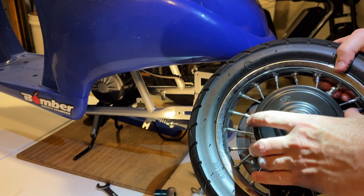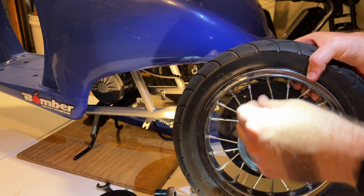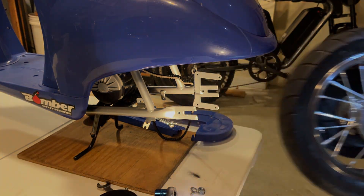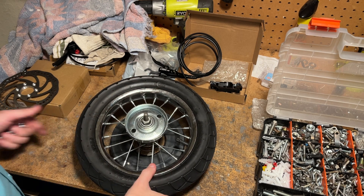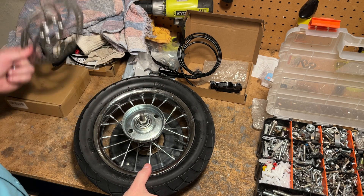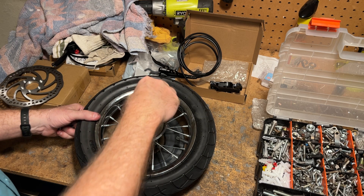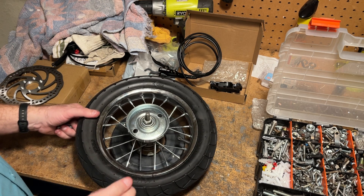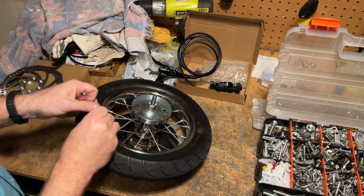There we have it. I'm going to remove this brake. This is the drum brake that I need to remove and then attach the disc brake to. In order to remove the factory drum brake, you need to turn it counterclockwise and then install the disc brake. But to remove this, it's quite a task. They do make a tool that locks into these two holes and it's easily removed, but since I don't have that tool, I'm going to try a method I saw online.